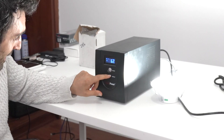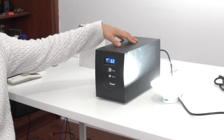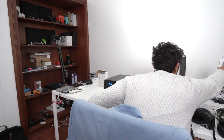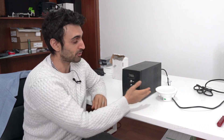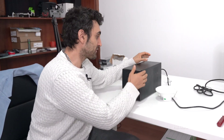The display says it's currently at 62% charge, so it should have battery inside. If I leave it, it will keep on charging. However, I just turned off the power — it tried switching to battery backup mode and the light instantly came off. So there is a problem with this UPS unit, and we're gonna fix it.